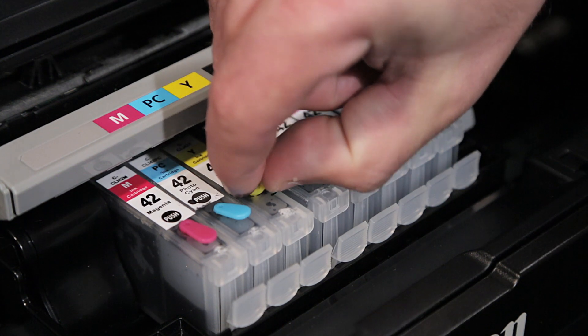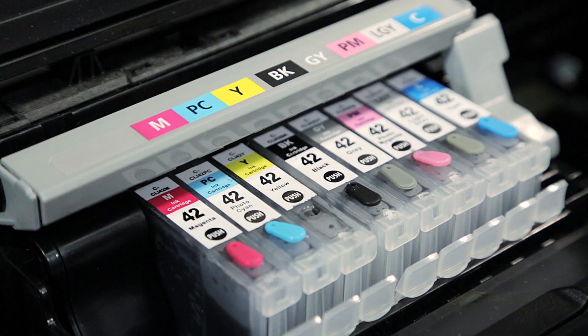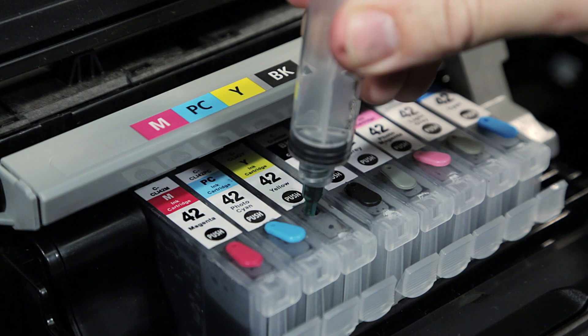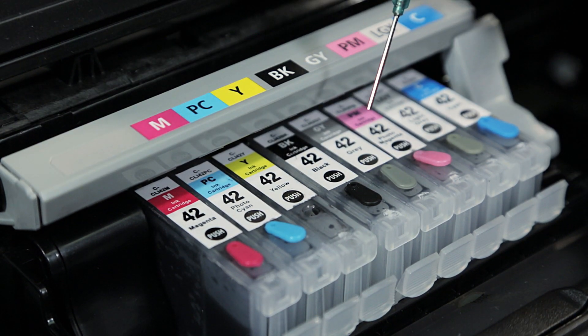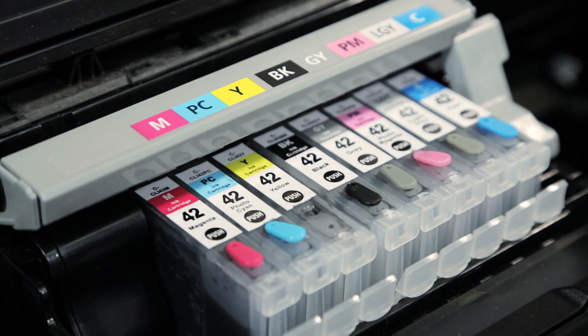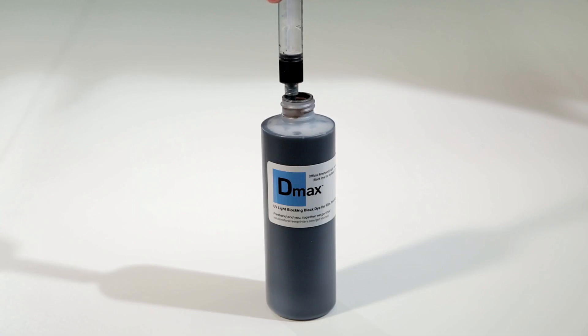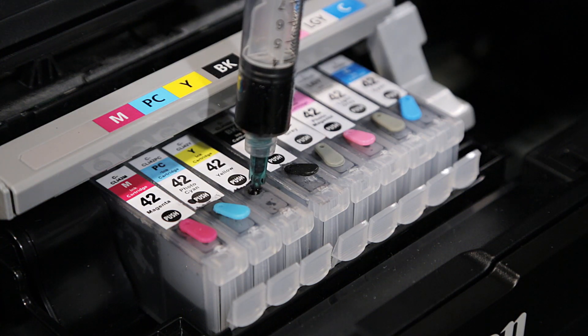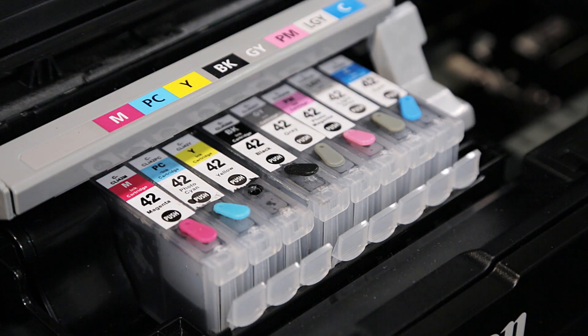Now remove the injection hole plugs from the top of the cartridges. Using the supplied syringe with the blunt needle wiped clean, insert the needle vertically into the insertion hole using it as a dipstick. If no ink appears on the needle tip, it is safe to add 4 ml of ink to the cartridge. Check each tank — tanks should be the same or have close to equal ink levels. Fill all tanks evenly for the best performance. Draw ink into the syringe, then slowly and carefully refill each cartridge with 4 ml of D-Max Filmmaking Dye Ink, allowing the internal sponge to absorb ink as you fill, while watching out for bubbles or overfilling.